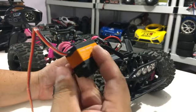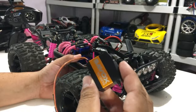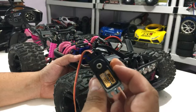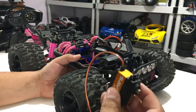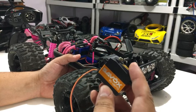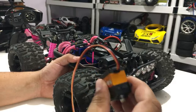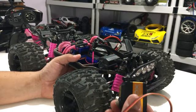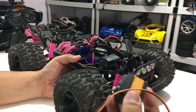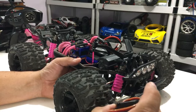Only fifth scale, you have been shouted out. Since I didn't get to utilize this in my Fortec, I decided, you know what, it's better to have a better servo for Stampinky. So I'm going to put this Savox servo, part number SC-1257TG. I think this would be a good servo to install into there. It's a little bit better than what's on the 2075 servo, and it has all metal gears in there. So that's going to be something that I'm going to be swapping out initially when I'm starting off.